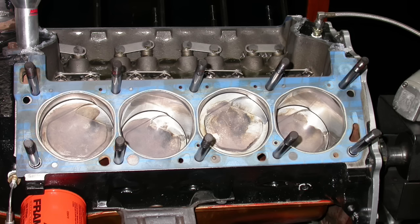After dialing in the timing and jetting on the carburetors — the carburetors out of the box worked fairly well, we only had to go down three or four jet sizes on both the primary and secondary side — we got a great curve. The thing ran flawlessly. It had plenty of valve spring to run the hydraulic roller cam out to 6,700-6,800 RPM, making peak power of 574 horsepower at 6,500 and peak torque of 512 foot-pounds at 5,000 RPM. So it just goes to show you — when you combine the head flow of a ported Cleveland, a good camshaft, and a cool tunnel ram intake, there's nothing better than a tunnel ram Cleveland.